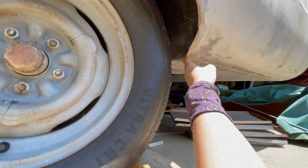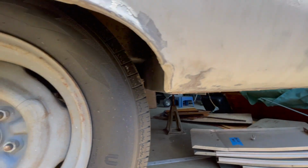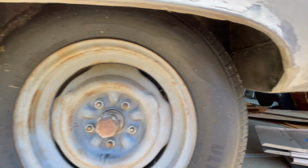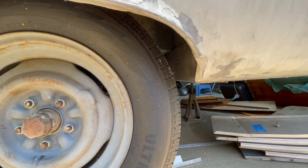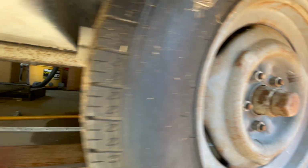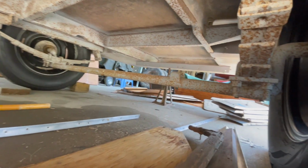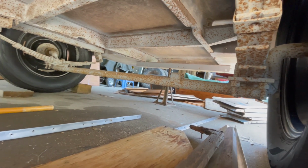in the wheel well. I mean, you're going to get closer and closer as you go up to this, but we're almost mid-tire right now. We've got a good, probably 3 inches on each side. But yeah, there's plenty of room up here, so that'll be low on the list, but definitely need to put a plate under that leaf and get some longer U-bolts.